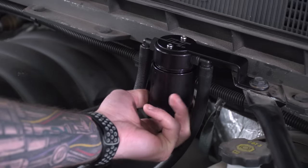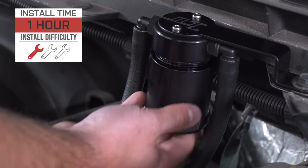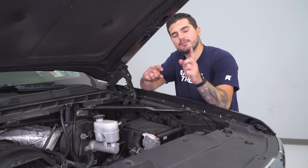When it comes time for routine maintenance, you just unscrew the catch can using that knurled textured grip bottom, dispose of the oil, and put it back. It's as simple as that — a very effective mod that has all upsides and really no downside, and it's super easy to install. At this point, let's flip the truck around and talk about our next one.